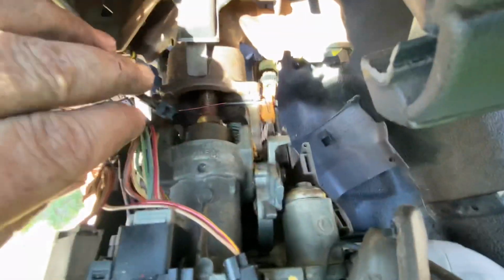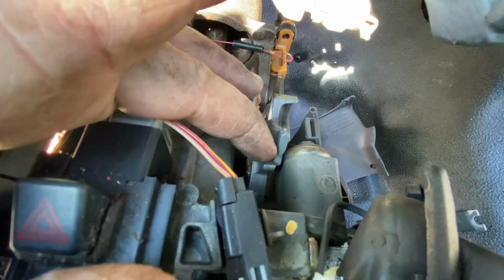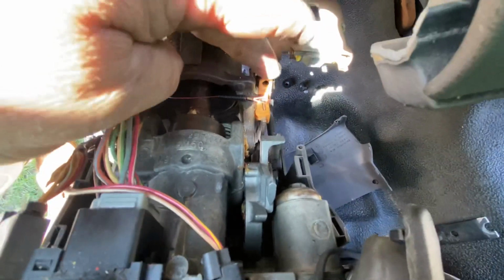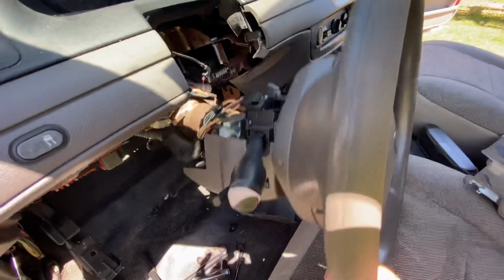Well, like in good fashion, you forget some stuff. This gear selector, you'll see it moving right there. See, it moves. That runs through this right here. It screws into here, and from there it comes down to here. Forgive me, y'all. It comes up and wraps around and comes up, and it's like a hook. So you pull on that, you'll unhook it, and then come up, and then you'll spin this until the threads come all the way out, and then it's free. And then from there, slide out. All right, y'all, there. Steering column's out.